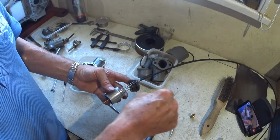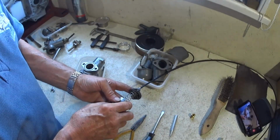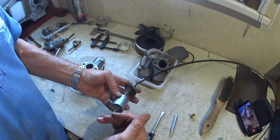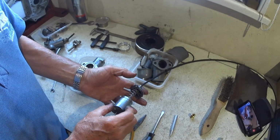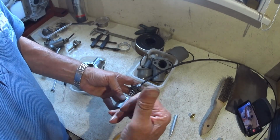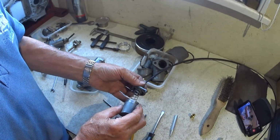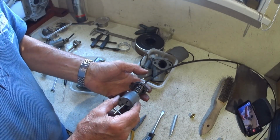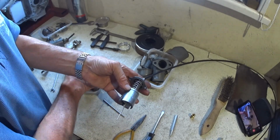So that's why they have one of those lawnmower type friction device levers. But you have to remember with the choke, it doesn't assist in starting the bike because the slide is always down and you're reliant on the pilot airways and fuelways, and if you give it too much throttle it won't start because it's giving too much air. So the choke only works when the engine's cold, when you're using the bike, so it can pull away with the cold engine and then keep progressively taking it off. I don't know whether Starfires were ever fitted with a choke. Definitely B50s weren't, or mine wasn't. Definitely the MXs aren't. So I don't bother with a choke. It's just another cable and another load of settings you've got to play around with.